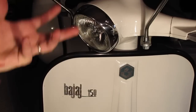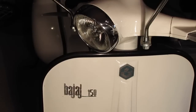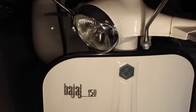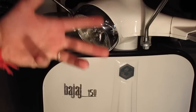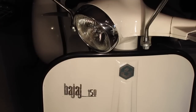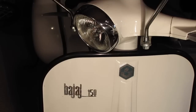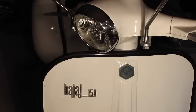LED, and of course it was super bright, but what I didn't see, and you would have seen on a scope, is that every time it swung up, it also swung negative a similar amount, and all of those negatives were strong enough to blow the little diodes that were in there, if there were even protection diodes in that piece of crap LED light that I put in. It might have just been the LED, the light-emitting diode, keeping it working for the most part. But once I revved it, I think, memory serves, I haven't probed it recently, so I can't remember all that well, and I'm not going to do it tonight because it's loud and I'm in the garage. But I think it was swinging from like 6 volts up to 17 volts or something like that AC. So it's all over the place.